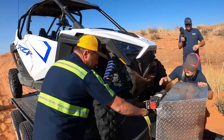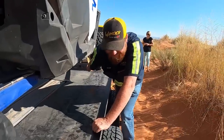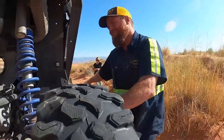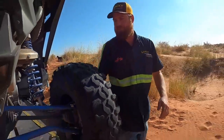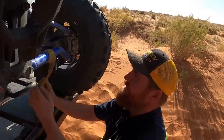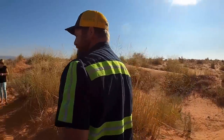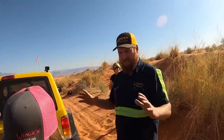A lot of you are mistakenly thinking that I'm having overheating problems, and I'm not — I mean, I could be. I'm working this thing really hard. We needed a radiator from Rudy's Jeep because we're building it up, so I decided to give him mine and buy a new one. In the process, I broke the shroud, so I'm running without a shroud. My new electric fan wasn't here yet — it's going to be here today. So we're up here in the dunes with no fan shroud on the mechanical fan and no electric fan at all.